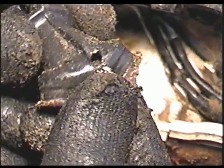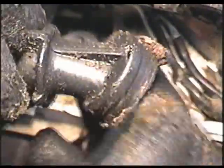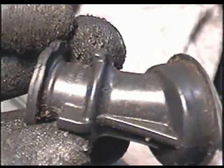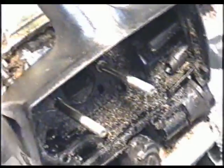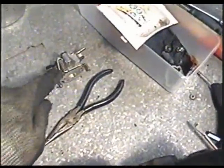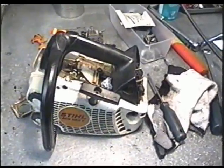And you can see where the boot is punctured right here. You can see a hole right through, and that will cause major problems. It can be hard to notice because it's hidden down in there, and people may not think about that, but that's definitely a problem. Anyways, I'm going to call and order this part, and in the meantime I've plugged the hole of the intake with a piece of shop towel. Before I reassemble it, I'm going to use my compressed air and blow out all the dirt that's in here. I'm also going to take apart the carburetor before I put it back on. So in my next video I'll show you how to do that, and we'll see you then.